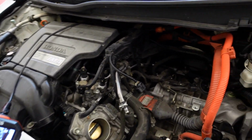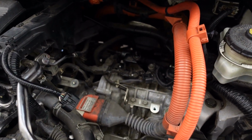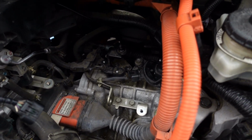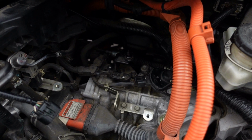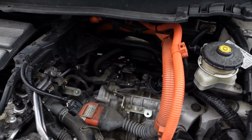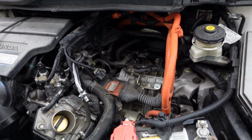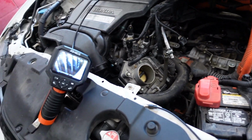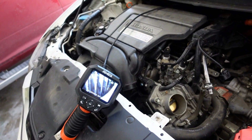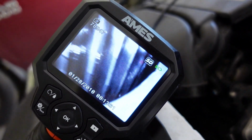I am hopeful that it hasn't spun. It doesn't seem like it did. Because if it damaged the case, then you have a big issue. But, you know, it is what it is. So, that's kind of what I think we've got. We've got a ball bearing failure internal to that transmission. And like I said, all the teeth on the gear look just great.